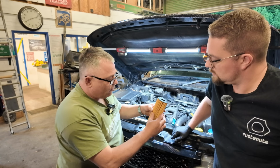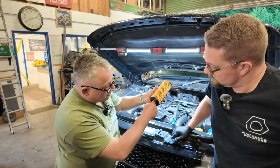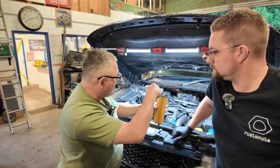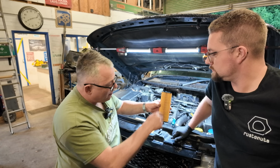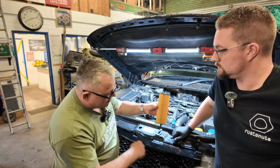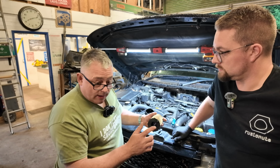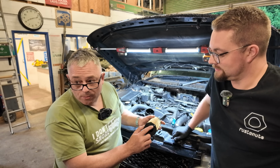Of course. So the oil comes up on the outside of the filter, through the element, and then it returns back here under pressure into the gallery of the engine, goes around the engine, and goes to the cylinder heads, goes through all the camshafts, and then it drips under gravity from the cylinder heads back down into the sump, apart from the turbochargers, which have got a dedicated drain back into the sump. So that is literally just a blank up. So that's why you had such a horrendous Exxon Valdez moment, because that was no longer blocking the drain hole up in the filter housing.